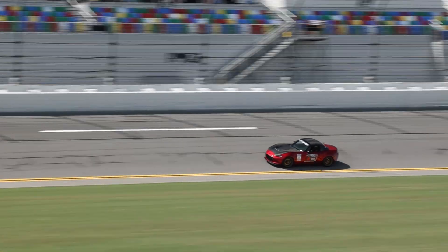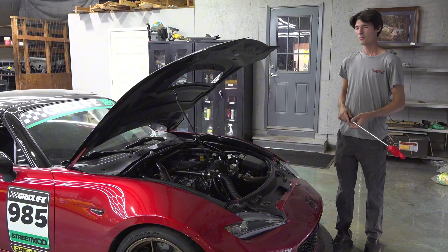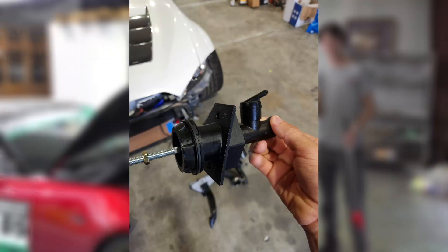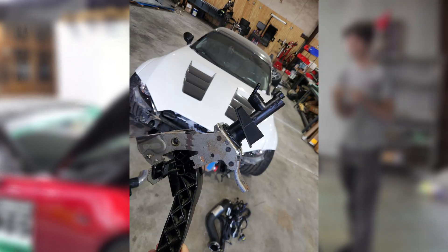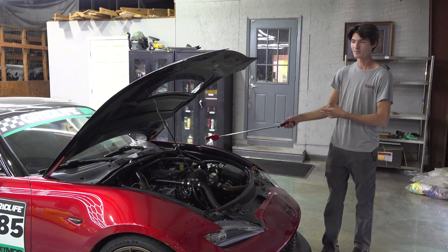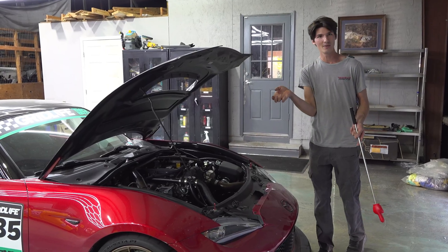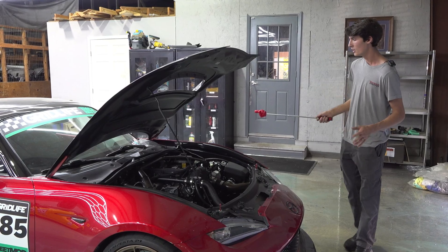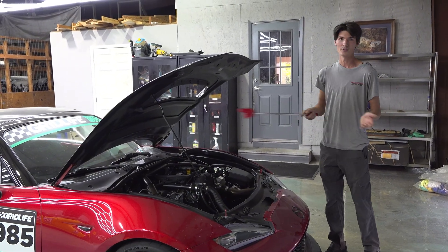Another thing to go with the whole EcoBoost kit for the Indy Miata is we have a custom CNC clutch adapter. These cars are really complicated with their clutch master cylinder — it's a plastic master cylinder that you simply click into place, and the pedal has no physical bolts, it's also a plastic clip. That makes it really hard to put a Wilwood master cylinder in there to make the MT82 internal slave work. So we made a CNC part that clicks in just like OEM and another CNC part on the tip of the Wilwood master to also click into place just like OEM. That master cylinder should last the lifetime of the car, it's serviceable unlike the factory Mazda's, and you can adjust your pedal unlike the factory Mazda's.